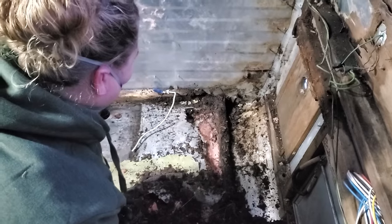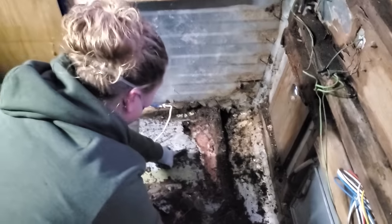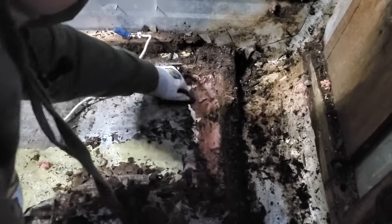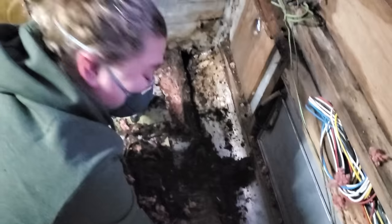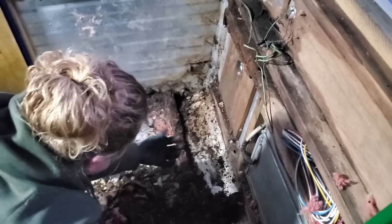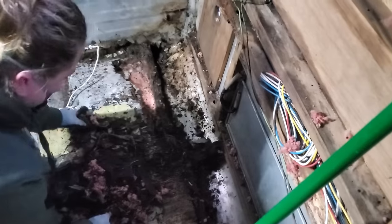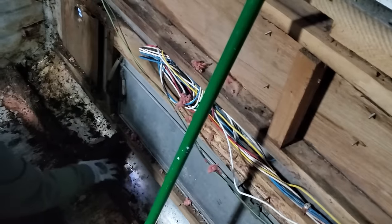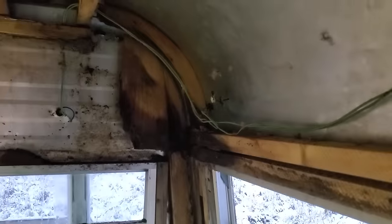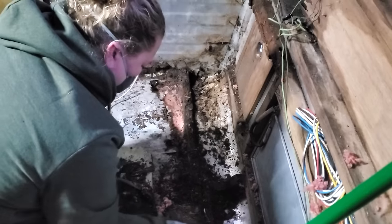So, we are finding that, like, this is the subfloor. And I think the only reason I can't take more handfuls of it out right now, this is it here, is because it's waterlogged and it's frozen. So we did not anticipate having to do subfloor, but we should have. You think? I mean, yeah. We knew there was a leak. Just goes to show you, if there's a little bit of water showing somewhere coming through, chances are it has made its way elsewhere. When you see the water damage initially, that's probably about 10% of what's going on.